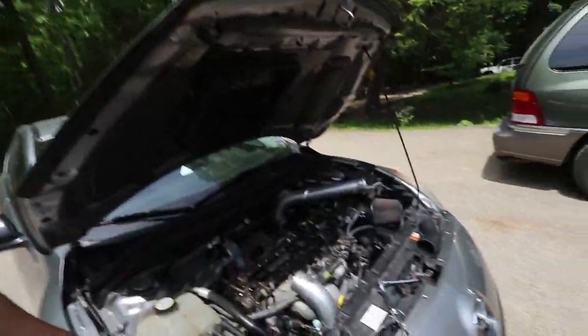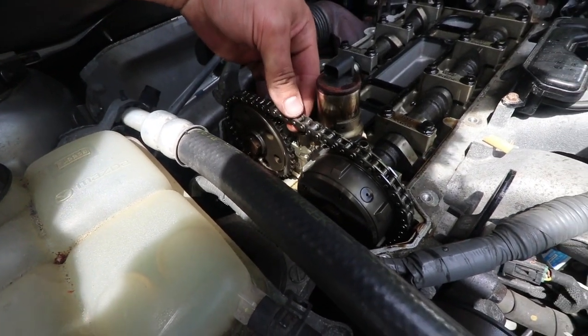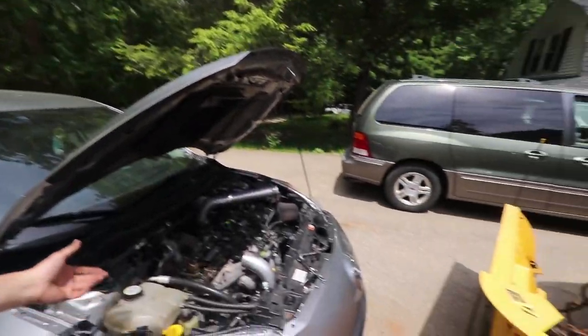Time for a built motor, I don't know. But yeah guys, it should not do that. So now you guys know — check for wear marks on your valve cover. And if you hear some rattling when you start your car for like five seconds, most likely it's the VVT, so be sure to check it because you don't want to blow your engine up.